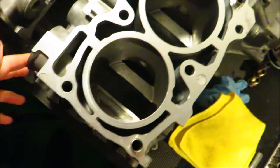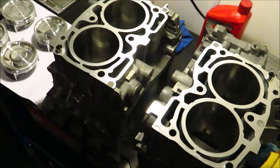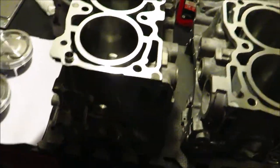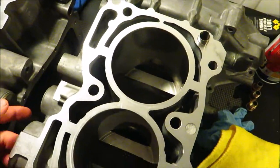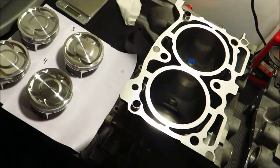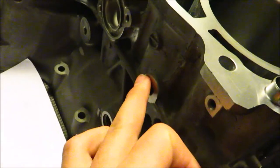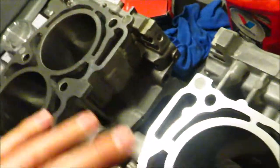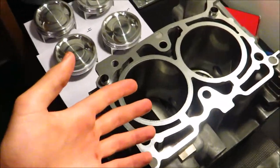This is the EJ255 engine I pulled out of a junkyard. A few months ago I took it to Outfront Motorsports in LA and had them do a resurface job, bore it 10 over, and a few other things. I had this engine bored out to perfectly match these forged pistons I have here — you need a special tolerance between the cylinder wall and the piston itself. Every flat surface has been shaved, the oil pan mating surface, flywheel, everything's been resurfaced.